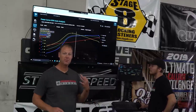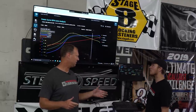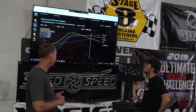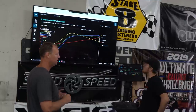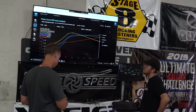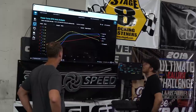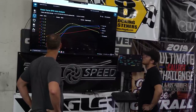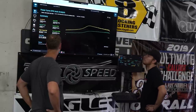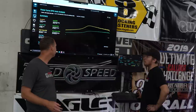We have done our first three pulls. We did a max power pull, a valet pull, and a towing simulation with about six and a half PSI in the AFC housing so we can repeat it for the next set. Now we're going to quickly go over the graphs, look at EGT, boost, and stuff like that. This is full power with the 5x11s — 1,375 EGTs at the very end, 44 pounds of boost on this 67-67 charger. We hit 416 horsepower and 844 foot-pounds of torque through 5x11s. This is a pretty mild setup, still good power. This charger has plenty more in it — we've done over 900 horsepower in this charger — which is what we wanted.